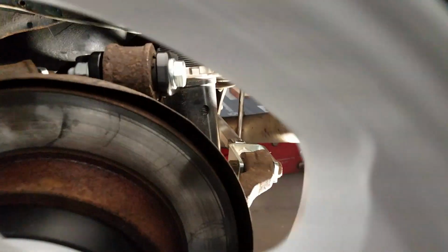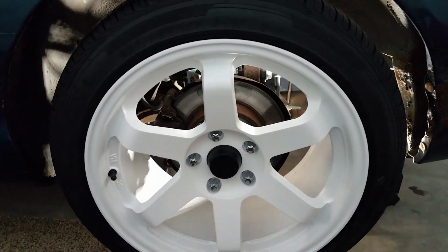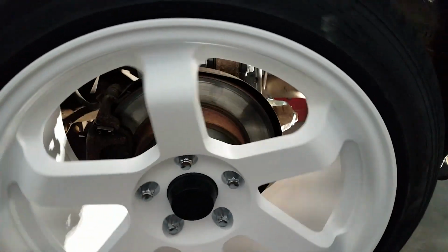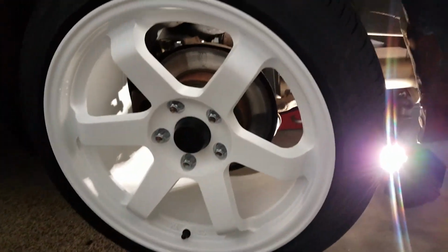All the suspension arms are all tight. I got a line, it's about -1 degree in the rear, hopefully 0 toe also, and I got to test fit the new drift spare with the 1-inch spacer. Should be pretty good. I guess I'll lower it.